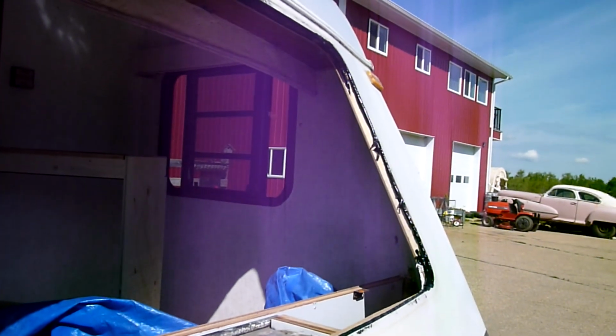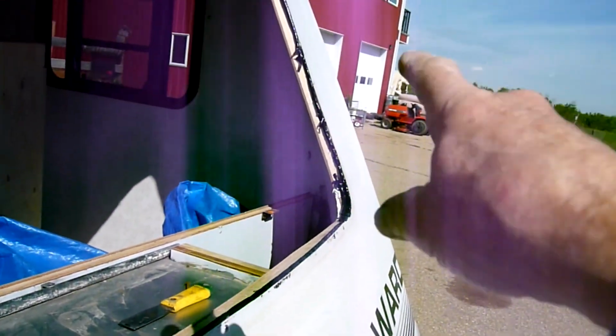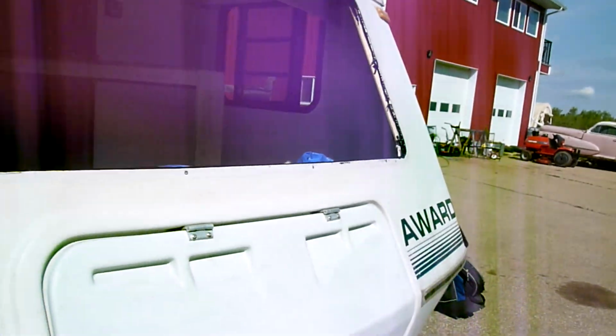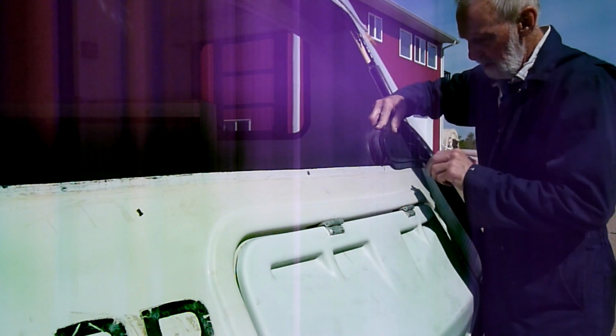So now to feed the rubber in. And originally the seam of the rubber was on that side right there. So that's where it's going back. It's important to flare the rubber to make sure it clears the caulking, doesn't smear it down the side of the trailer like that. And it will go on both sides. You don't end up having to fight it.